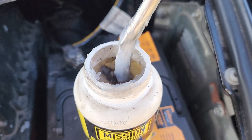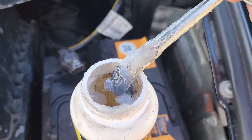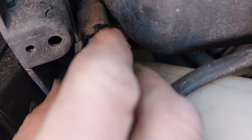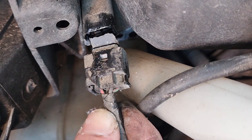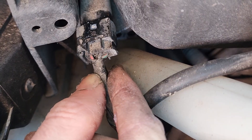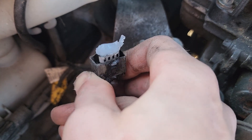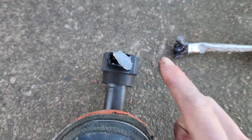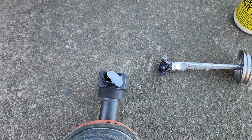So how do you apply this stuff? Always remember dielectric grease should not be applied to mating surfaces where a connection is not tight enough to displace it. Apply this only in solid connections — you push the connection together based on friction and it should push the dielectric grease out of the way. Don't use too much lube as it attracts dirt and debris, which can cause more problems than you originally started with.